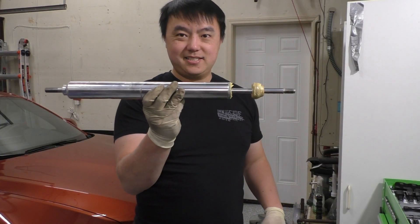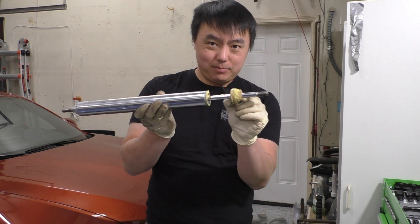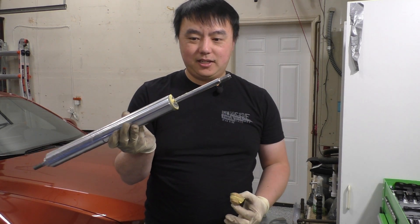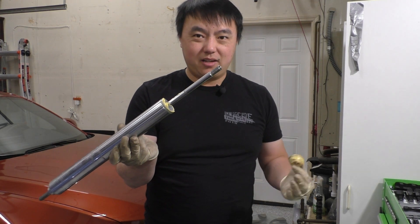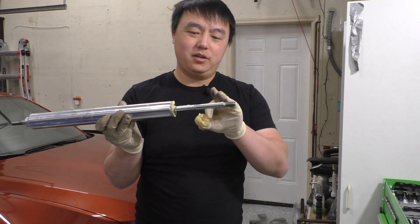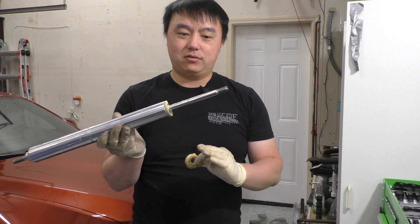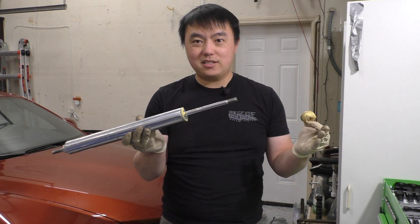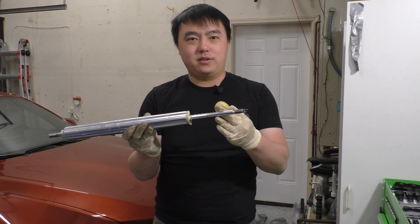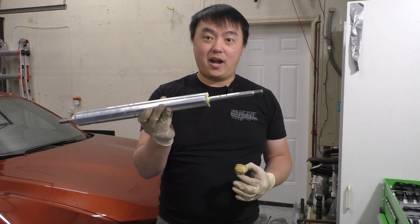Here is what is inside that strut body. It's not too much — you have this little bump stop and the damper piston shaft itself, which is also not very large. Part of the reason they probably use this inverted design is that since they don't need a large piston shaft to carry lateral forces, they can get away with using a smaller one, and that lowers gas forces. Those gas forces lead to worse ride quality and delay when the damper actually starts to act as a damper.